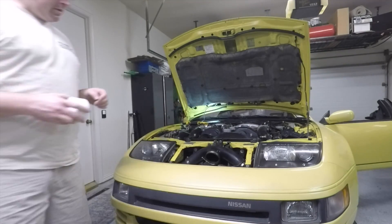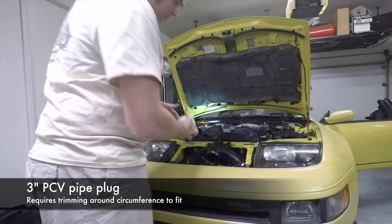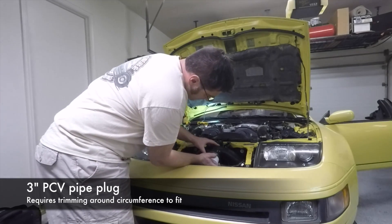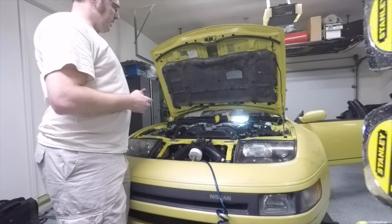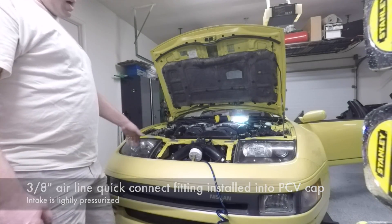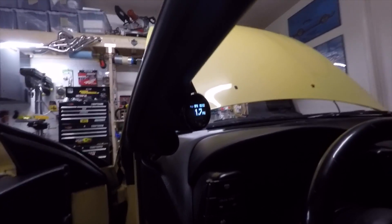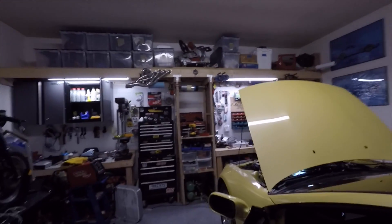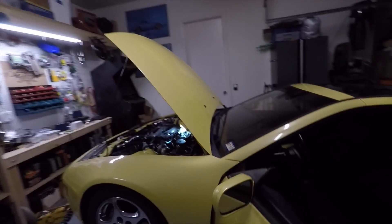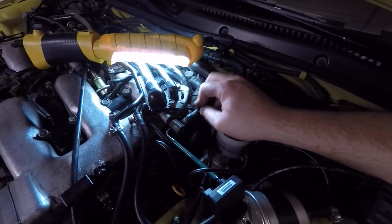This is another Z1 unit. I'm pretty sure I've got an intake leak — I got this little PVC plug and figured this would be a good time to see if it fits. At idle my fuel trims are way off; it's dumping a lot of fuel and this gauge is reading about 1.7 PSI. While I was trying to figure things out, I was just over here listening, and there's my leak.